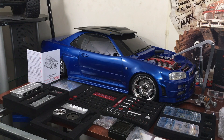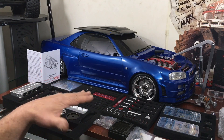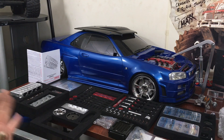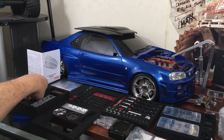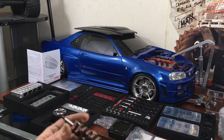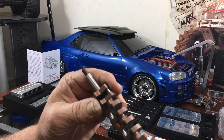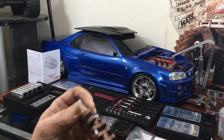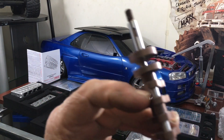Especially when building an engine, this is a very fine piece of machinery and everything is made to work within its own tolerances. They've done a phenomenal job building this engine. One drawback I did hear from a subscriber: his crankshaft broke between the second and third journal on his sixth tank of fuel — so there may have been something faulty in the metal, but it's a pretty stout crankshaft.